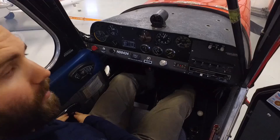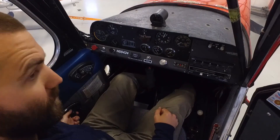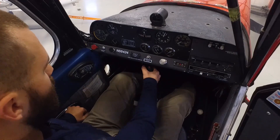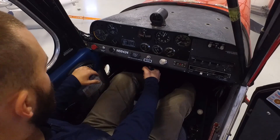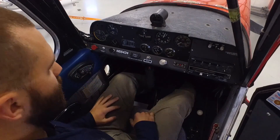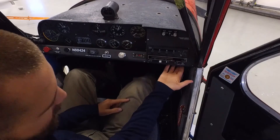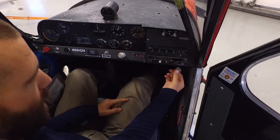And finally, back here we have the elevator trim tab. We can move that and we've got an indication for takeoff position. It's very intuitive to operate this handle while flying the aircraft — the pilot works his right hand on the stick and can easily move his hand from the throttle and carb heat right down to the trim to adjust. So it's a very intuitive and comfortable airplane to fly. Down here underneath the dash we have a parking brake we can pull on.